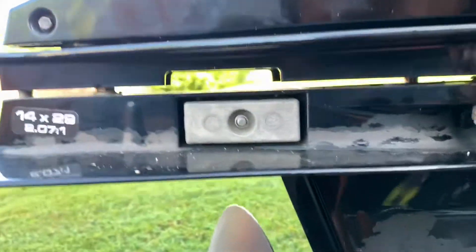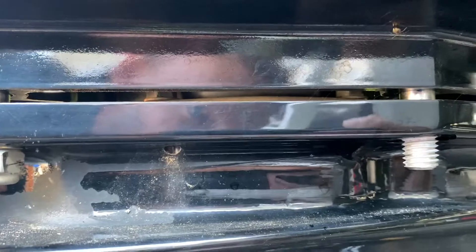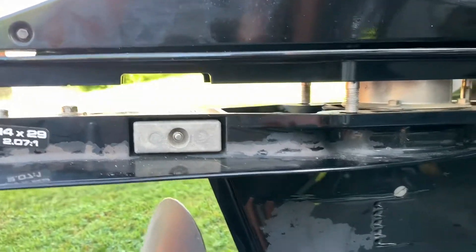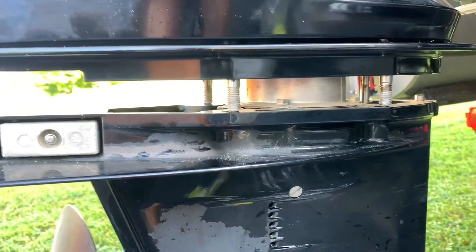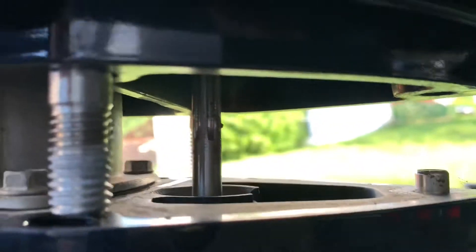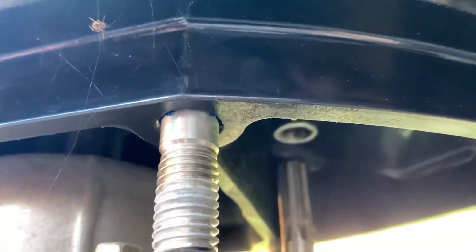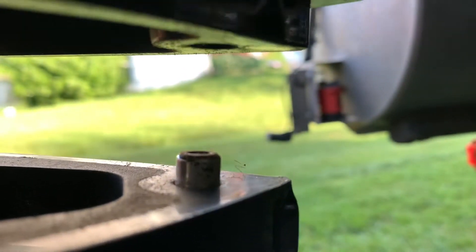You can see the daylight coming between the upper and lower unit - she's loose. I'm going to start pulling down. I wanted to stop and show you this: that gray piece right there with the bolts on top is the housing for your impeller. Now I've dropped it down a bit more. This is actually a really good design - on older outboards you have to disconnect the shift linkage and the speedometer hose. On this one, that silver shaft is your shift linkage, and as long as you have it in neutral, it goes right back up into a little shaft by itself. The speedometer tube does the same thing - great design.